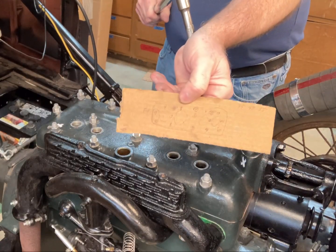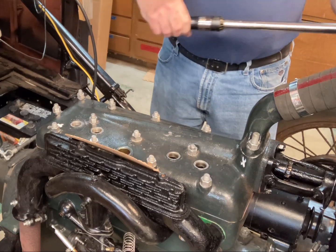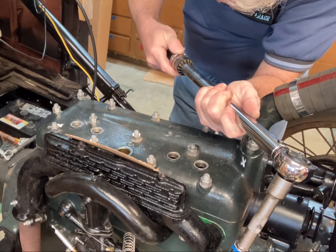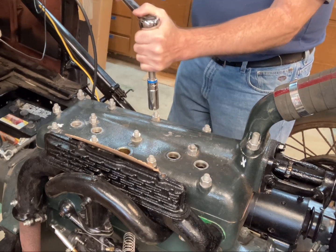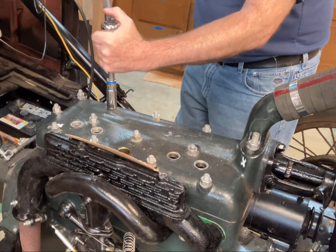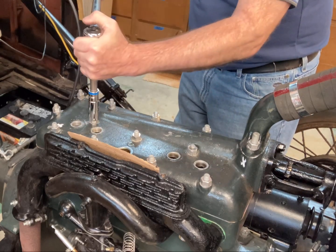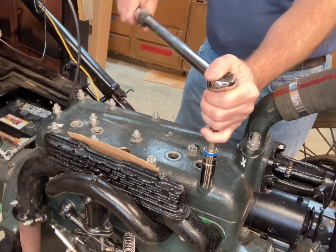Okay, now using my little sheet here with the proper markings for where the distributor is, we'll dial up. The first setting is 35. So what you do is you pull this collar down and turn it till you get to 35. And then you go through the numbering sequence. I had already gone through and tightened these, so this is just verifying. And you basically start towards the middle and kind of work your way out. But I'm following the number diagram too that was in the book.